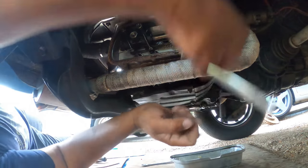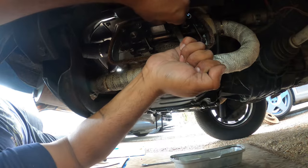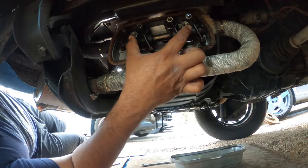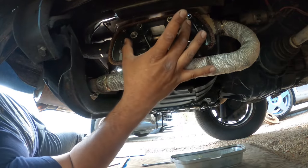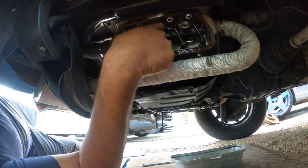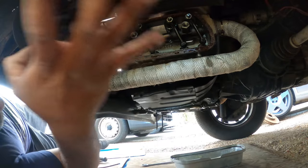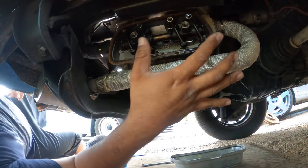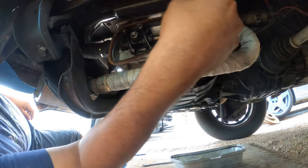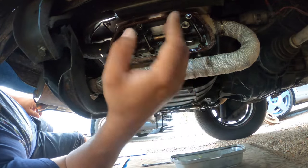Now double check it one more time. All good. One thing I recommend is double check your torque specs on these guys as well while you're at it — sometimes these like to get loose. On top of that, you can check your head studs — these guys right here. You should have a couple studs sticking out right here. Also recommended to check your torque spec on these while you're at it. I did mine a couple months ago, so I'm good. But again, I needed to do my valve cover gaskets and obviously a new oil change as well.